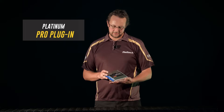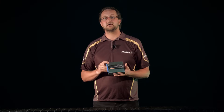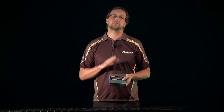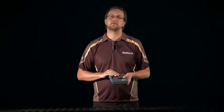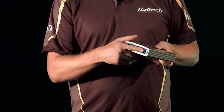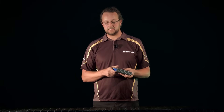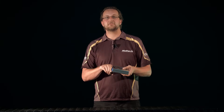There are a bunch of different ways you can wire your car, starting with the simplest: a direct plug-in. What we've got here is a direct plug-in for a Nissan S15 Silvia. We've got a huge range of pro plug-ins, so jump on the website and have a look to see if we've got one to suit your particular model. This has got the factory ECU connector, so all we do is remove the factory computer from the car, plug the factory harness straight in, hit the key, and the car will start and run.